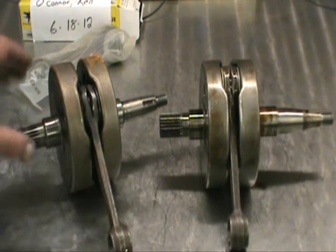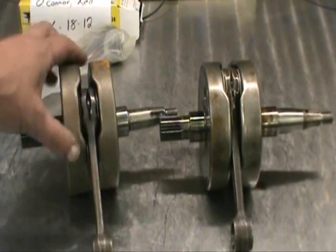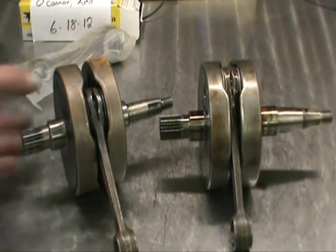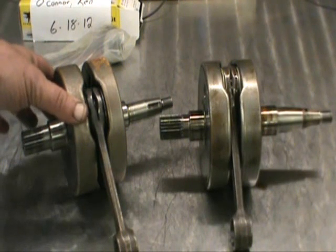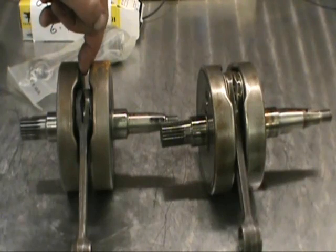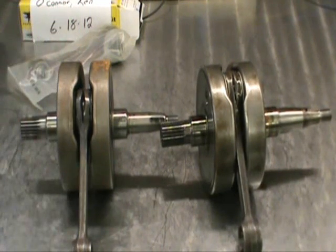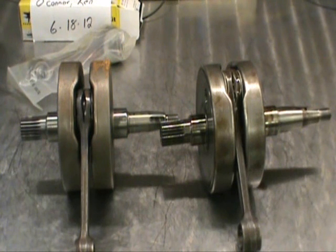The reason they say that is this solid part of the crankshaft is solid steel — the pin gets pressed through it. But these, what I like to call pin cans, are just sheet metal pressed into the crank. I took one apart years ago and I know what's inside. When you put your press block in and attempt to pull this piece off, it's going to bend all the sheet metal — the sheet metal will give out. Many years ago we played with it and made that mistake. You can whack it around and make it work, but it's just not the right way of doing it.